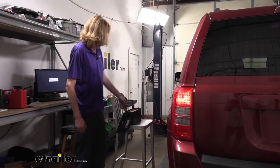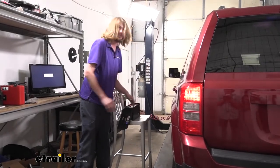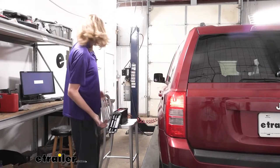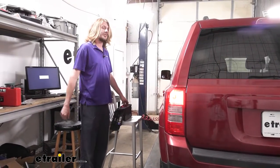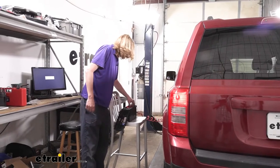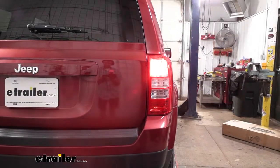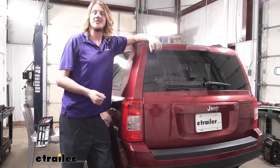We've got our motorhome simulator here. The seven-way connector is plugged into the box and the six-way connector that we've got at the front is plugged into the vehicle. We're going to start with our taillights — you can see them on the vehicle. And then as we run through our signals, we're going to go ahead and do our left turn signal — we can see that working there. Our brake lights — you can see that they're brighter now. It also activates for our right turn signal.